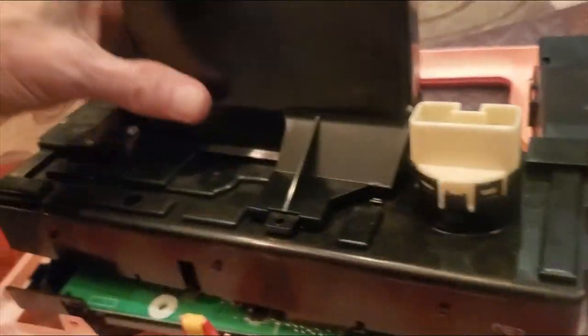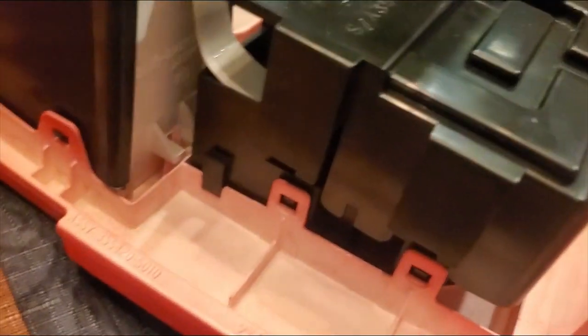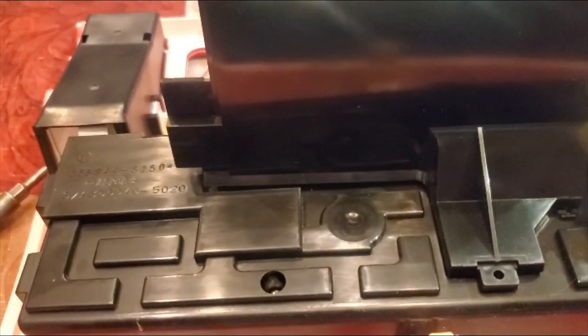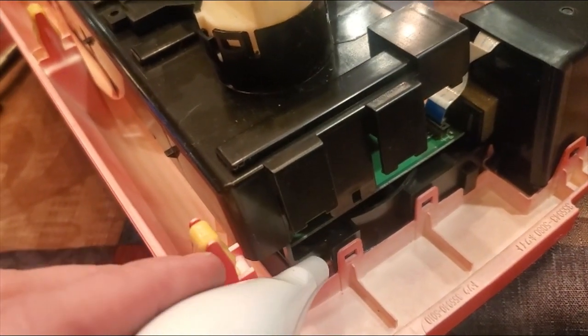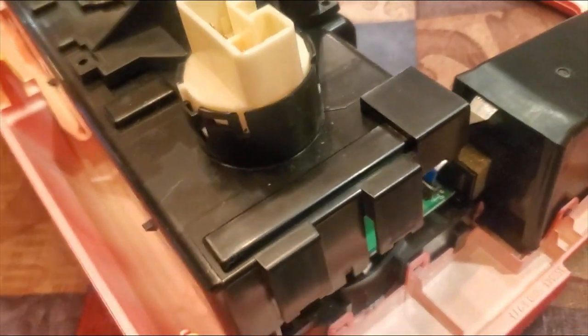Now that's loose, you don't have to tear this all apart — just enough to get to these little clips right here and here. You loosen those on both sides, and these two as well, and this whole assembly should come off. You don't have to take ribbon cables off, at least not yet. Just a little bit of pressure there, and all you need is one side — when you get one side, the other side will come loose. Now the whole knob assembly is loose.